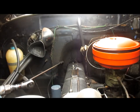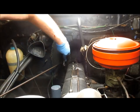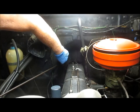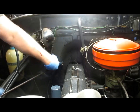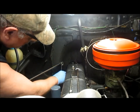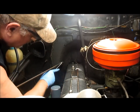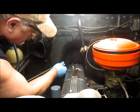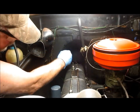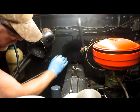That valve cover is just going to block my way. I'm going to have to take a wrench too. That's all right. If you see it's not going to turn, don't round it off. They're not that long anyway. This old 216's been blowing all kinds of oil for miles and miles and years and years, so there's an oil film all over this engine compartment. Makes it a little slippery.